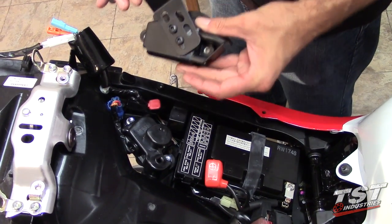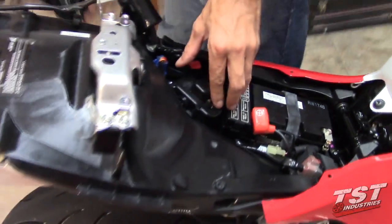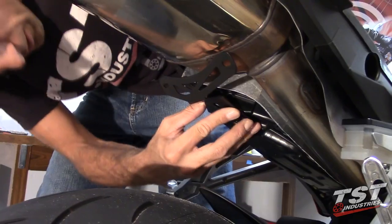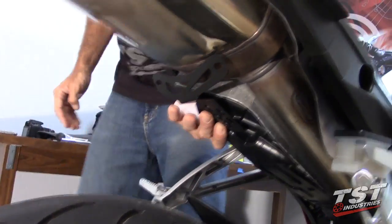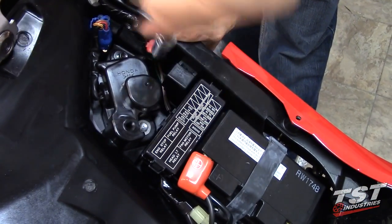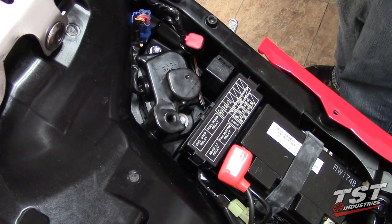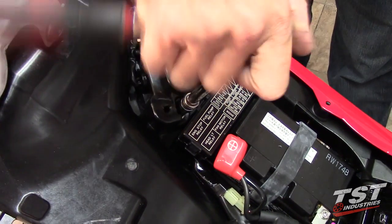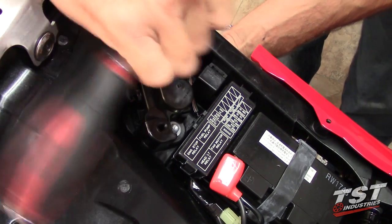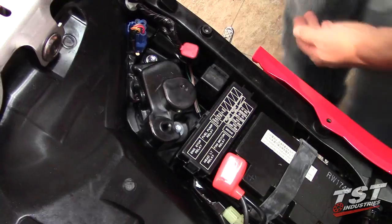All right, now we will reattach the assembly back on the bike using the servo screws. So if we go to the bottom, you insert this assembly back where it was. Hold it with one hand, come back up to the top, and screw in the fasteners. And you can go ahead and tighten it now with tools. Make sure you get proper engagement of these fasteners, otherwise this assembly will likely vibrate out on you. Now let's go to the bottom.